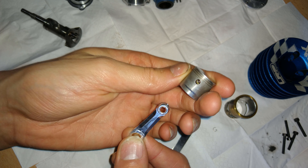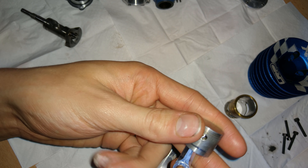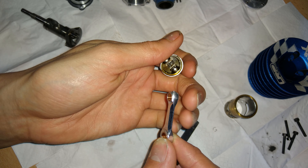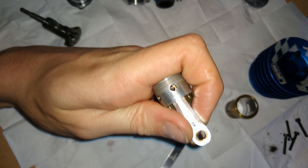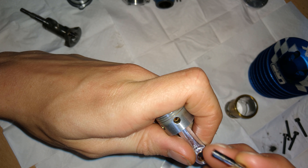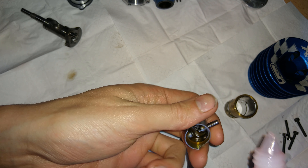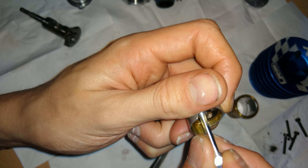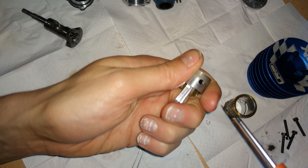You want to make sure that the piston skirt is facing the exhaust. I made the mistake before in one of my older videos where I had it the wrong way — you do not want that, otherwise you won't have any oil coming up to the top bushing inside your piston, because the groove brings it up and out there. The good part about this engine in particular is that you can only insert the crank pin one way, so you can't really put it in the wrong direction. I also like to use some oil on the crank pin to get some oil on the bushing before inserting it.